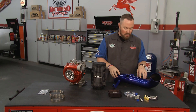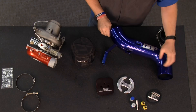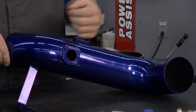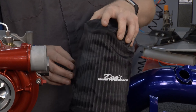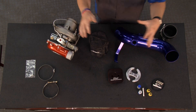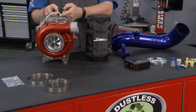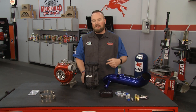What we're going to be installing on our LML-equipped 2015 Silverado is this neat 4-inch air intake system. It is mandrel-bent 4-inch pipe with CNC machined bracketry for our sensors that came off the factory engine — they bolt right in. It comes with a high-flow dry-media AFE filter — the dry-media stuff is cool because you don't have to keep oiling it. You also get a neat pre-filter which helps extend the life of your air filter by keeping larger particles from getting caught in the pleats. All of this is a very holistic package. If you build your truck in stages — upgrade the fuel system, upgrade the turbo, upgrade the air intake — sooner or later you're going to have a very high-performance factory hot-rodded diesel truck. John's got the install going.